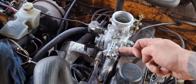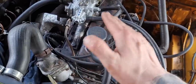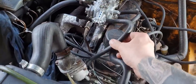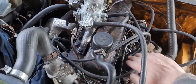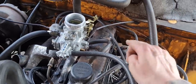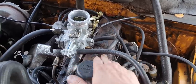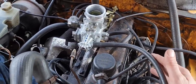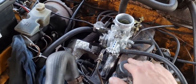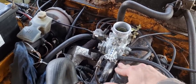The fuel intake on this Weber is here, pointing that way. I'm just doing a makeshift connection for now — I'm going to cut into the hard line here so the fuel pipe runs down to there. What would people do — would they just rubber hose it directly from the fuel pump? Do you need some sort of hard line? Has anyone got a Weber carb on their Viva HC 1256? I know someone had emailed us about theirs and sent pics but I couldn't find them.